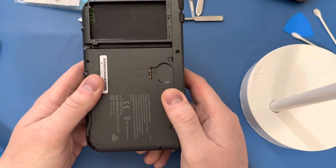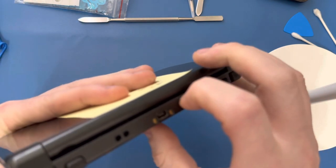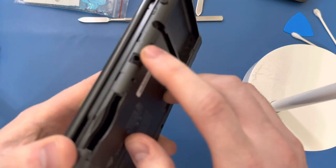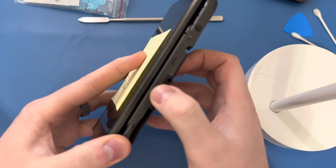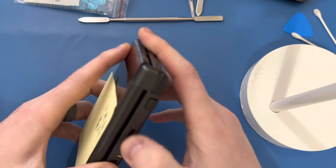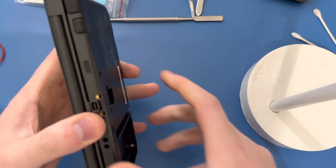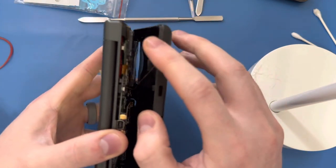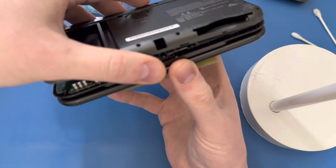Removing this back plate is easy once you do it the right way. There's a line here — find the gap, pull up from this first only a little bit, and then push forward. The reason for that is there's a little headphone jack right here with a plastic piece that lips underneath it. If you try and yank up on this you will actually rip out your headphone jack. You can use a guitar pick or whatever — just a little bit and that gap pops up almost immediately.